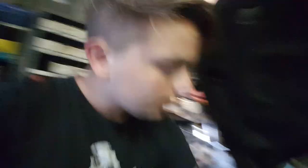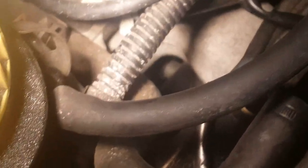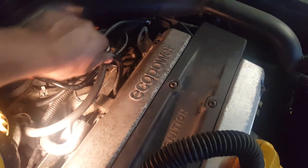I'm going to detach it and show you what it looks like. One hour later, I finally got that internal clip off — anyone that has tried replacing one of these knows what I'm talking about. In between the air intake manifold there will be a clip on that nub down there. It's this clip right here, and you need to push the tabs in and pull it out. Mine was stuck — I kept pushing down and had to slowly pry it off. I heard a little crack sound, so I'm hoping the nub isn't broken.